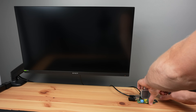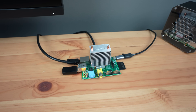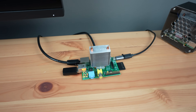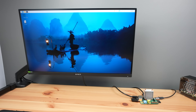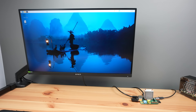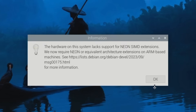I started with the original Pi, and its first boot and setup process was a lesson in patience. It took the best part of two hours to get the first boot complete, get the Pi updated, and all testing utilities installed. Even once set up, it takes about 8 minutes to boot to the desktop, and the CPU stays pegged at 100% for another 2-3 minutes before dropping to about 20% at idle. The original Pi refused to open the browser, so that's where my YouTube video playback test ended.